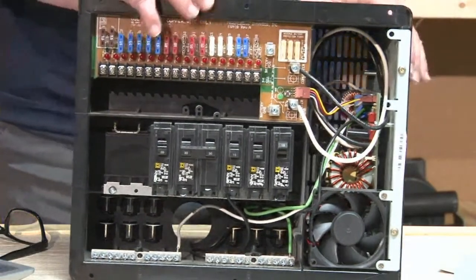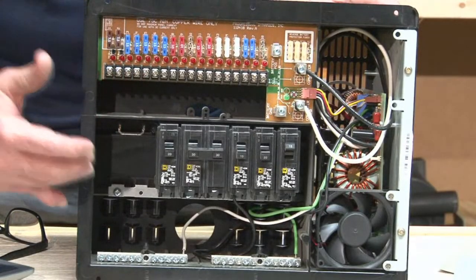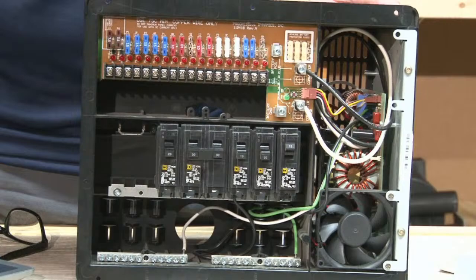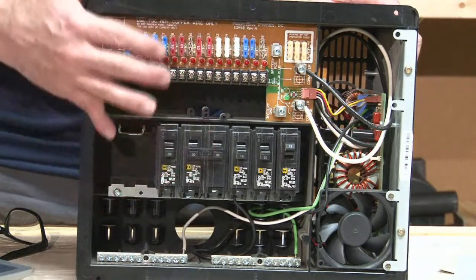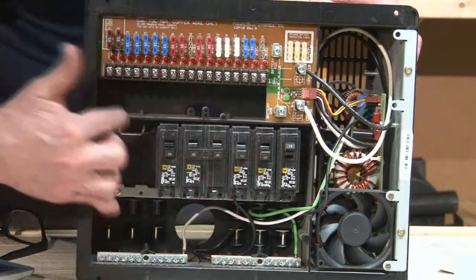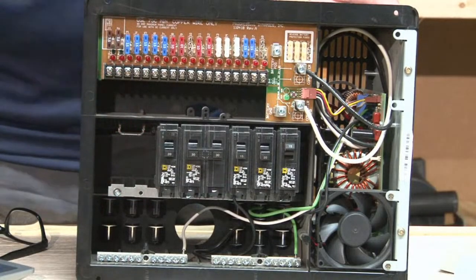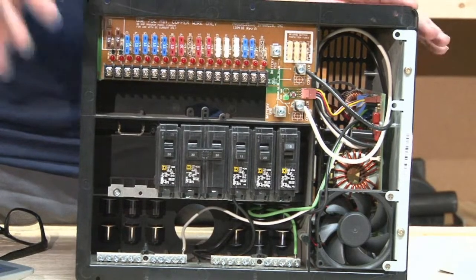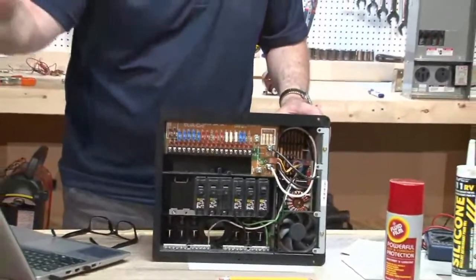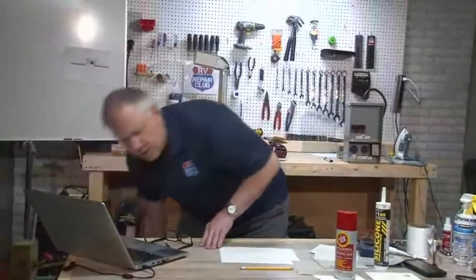So if you want to add two outlets to the back of it, you've got to find somewhere where you have an outlet that you can gang to, maybe back in the bathroom area. Actually, I probably wouldn't do the bathroom because that's going to be GFCI protected. Or you can come in and do your own extra. You can add, as you can see, a couple of stations in here, add an extra one and run Romex back and do the two in the back. I would definitely put it in some kind of conduit to shield it, see if you can get it through the basement, or like I say, daisy chain something that's already back there, but it's very, very similar to what you would have in your home.